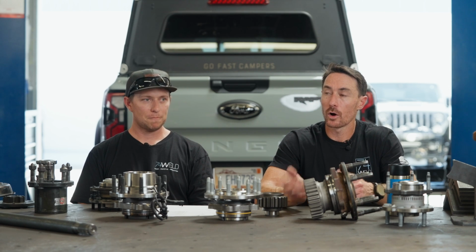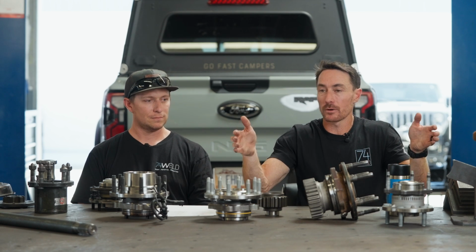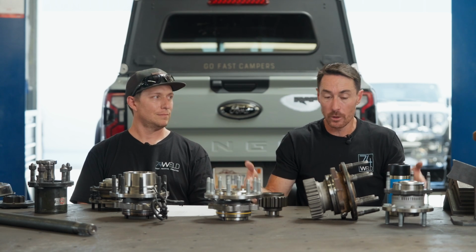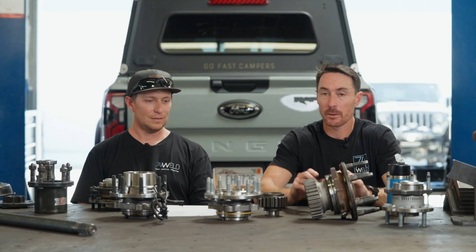Our wheels are 1 inch per side narrower, so while we're a little bit wider on wheel mounting surface by, say, an inch, we're 2 inches narrower overall via the wheel package, so we actually come in narrower than the big Dynatrac package.